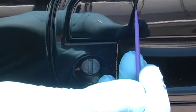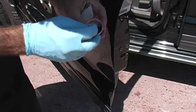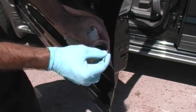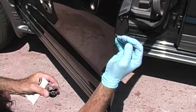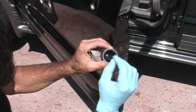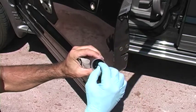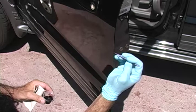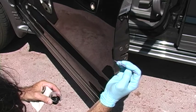There are a couple more chips on the door handle — this really makes the door handle look nice, and it's such a common area that gets banged with keys. Now we're going to do door edge chips, which is also very common — this is from the seat belt latch or clasp flying in the air. Notice I start at the top, using gravity to my advantage and working down the door rather than up. I'm resting the edge of my palm on the door edge and holding the brush between my thumb, index, and next finger. That makes your hand really stable so you can lay a really precision bead right on the chips.